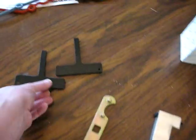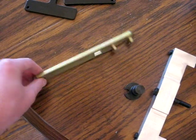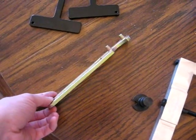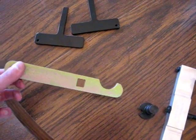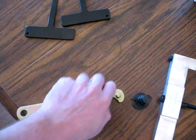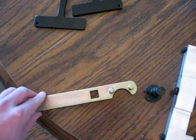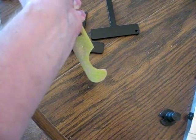You need two of these. This is a tool that helps you tension the cam gear between the two cams on each bank. These two pins here go into the cam gear and allow you to put tension on the chain.